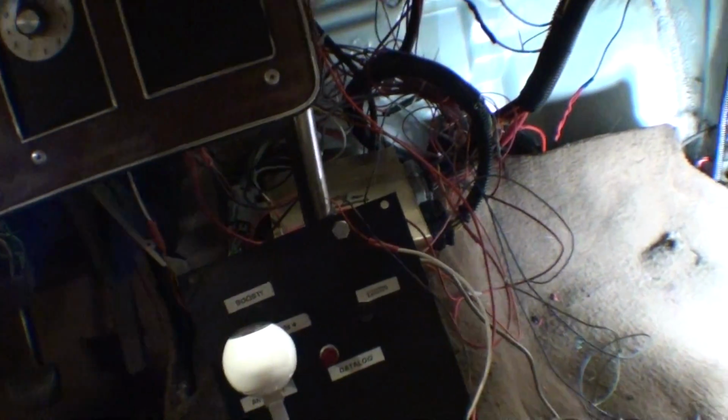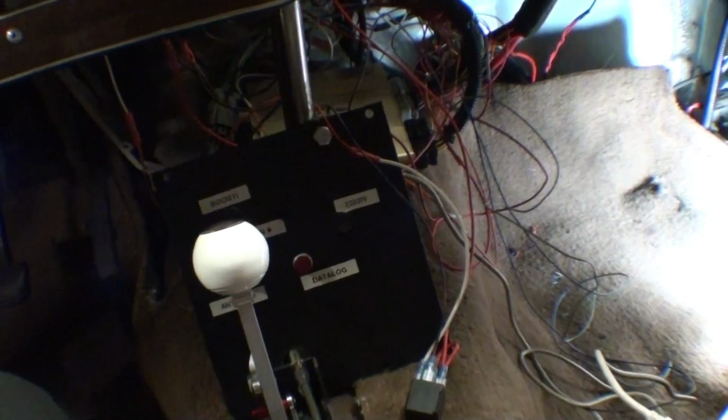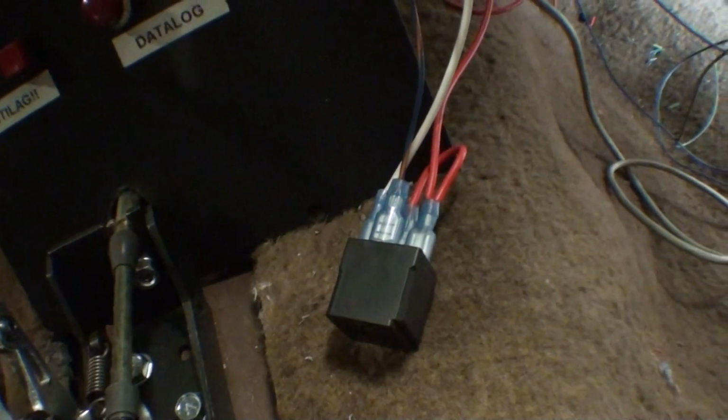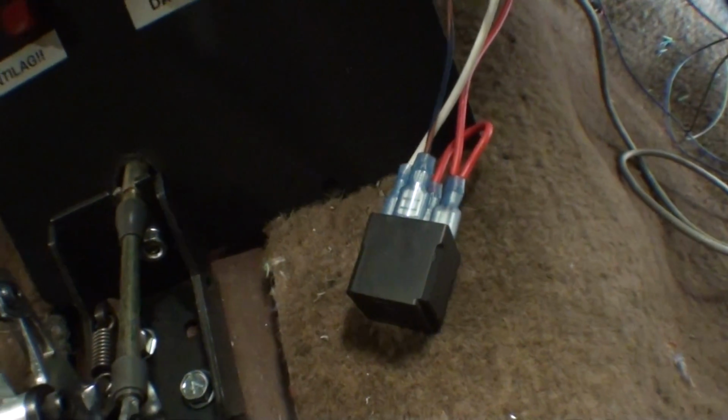What's awesome is it's included in the box. So if you wanted all of these cool features, like the boost controller and everything else, you spend $25 on a boost control valve instead of $300 at least for an electronic boost controller, and you buy a relay for $6 to $26 and you have a bump box. Because the computer you already bought can do it all.